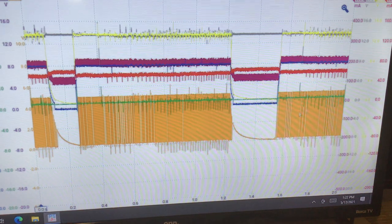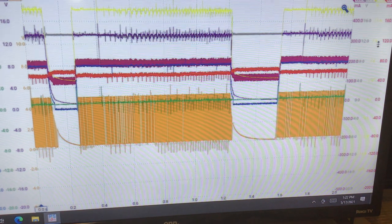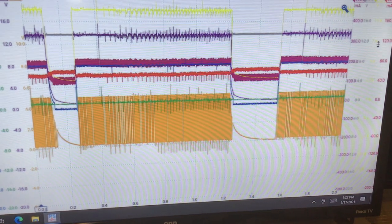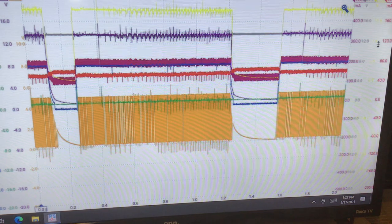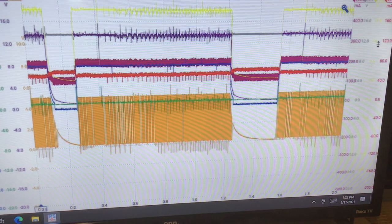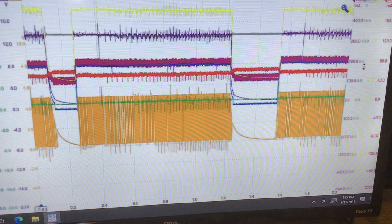We're glitching because of fuse 8. Fuse 8 would be, in this scenario, a loose fuse or have some corrosion on the blades that's real tough to diagnose. It may have had parts thrown at it, but nonetheless. So look at your schematic, look at fuse 8, and for 300 milliseconds, if that fuse did not make contact in the fuse box, let's look at what would happen.